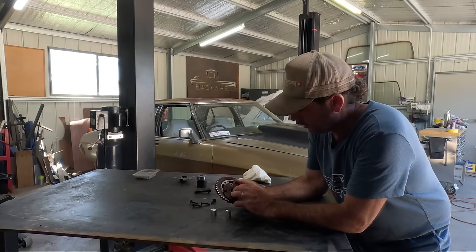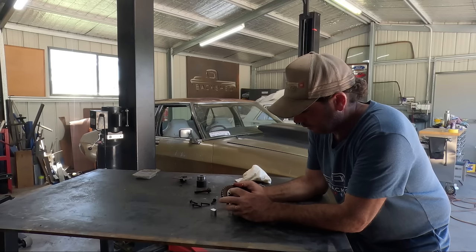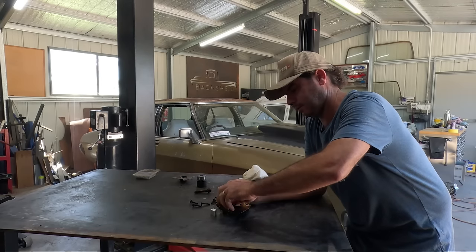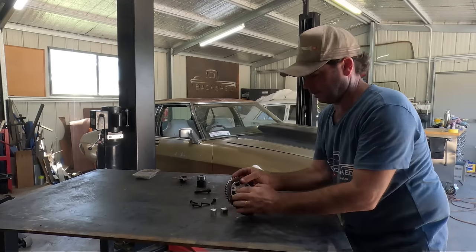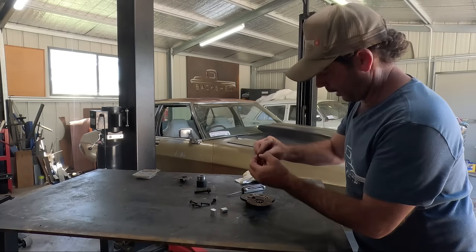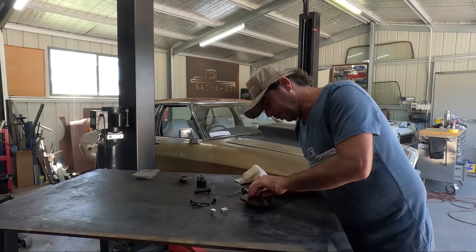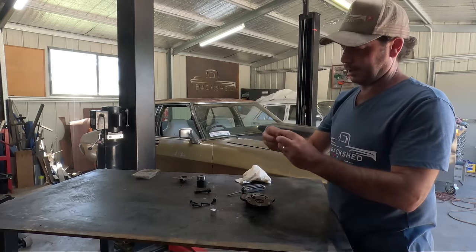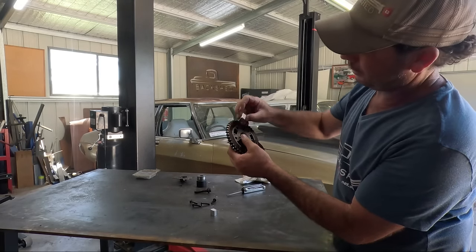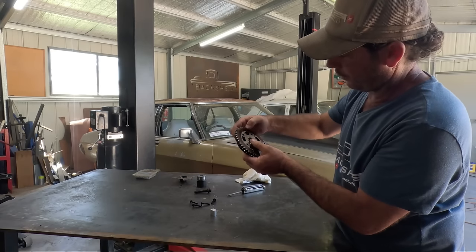Like I was saying, there's gonna be a plunger that tries to jump out here at me. And if I lose it, it doesn't actually matter now because the phaser is not going to be operational. That's hitting on the cam pin. And now it's not. And there's the little plunger. Oh, and the spring. I will put them back in for no reason other than my own peace of mind. However, they actually won't play any role at all now because we're going to lock them out with these little blocks. If you see that section there, it's basically the same shape, and those little blocks, although an incredibly tight fit, they will slide in.